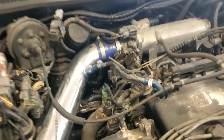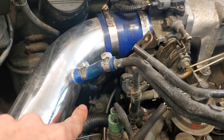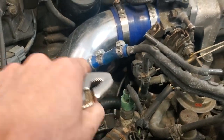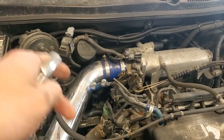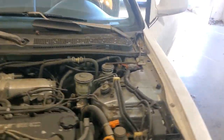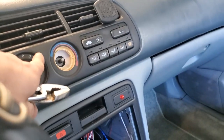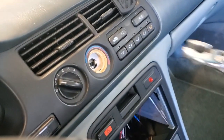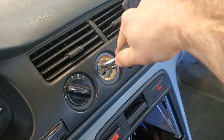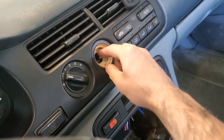Quick update: I was able to turn the heater valve by hand — that little valve with the wire connected to it — so I know the valve is not seized. I was going back and forth with it, I could hear it moving in the dash, but then it went 'funk' at one position. Something in the dash is causing it to get stuck, so we'll probably have to get in behind there and check if the cable is pinched or needs lubing. It does still spin freely.